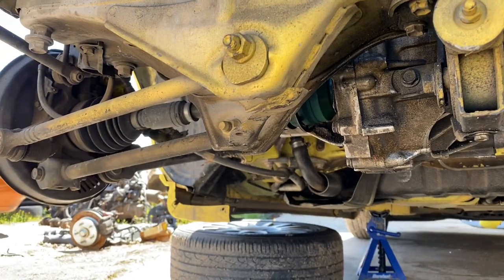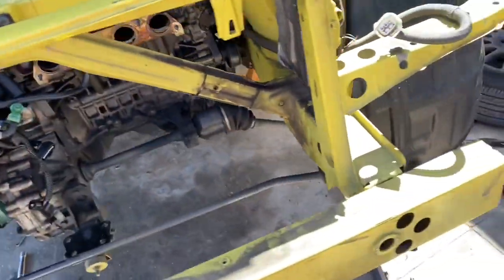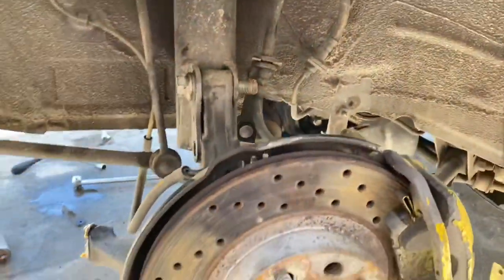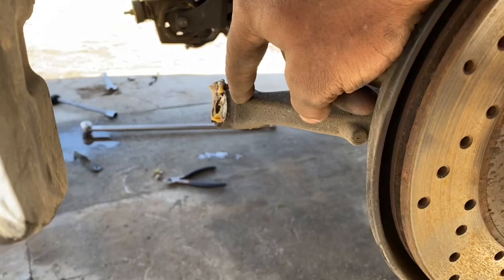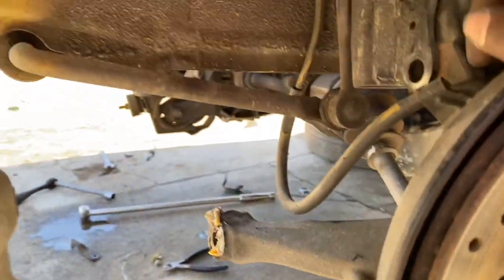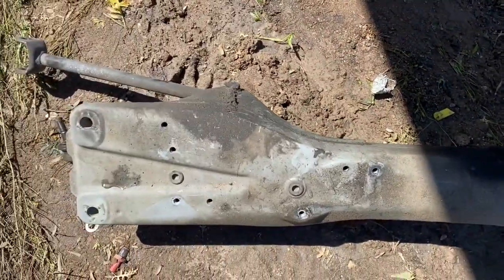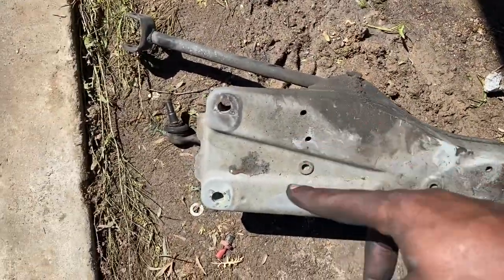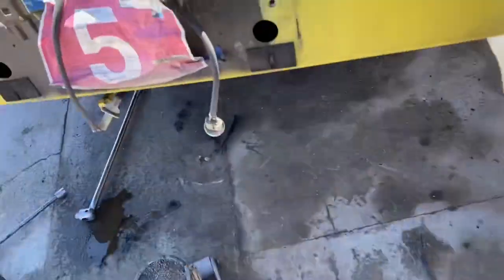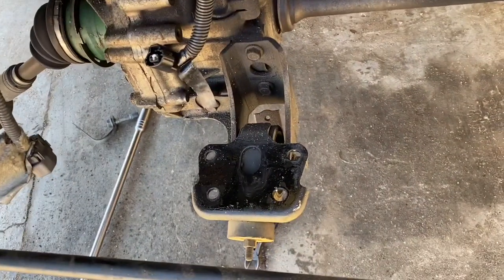We're back — I got my axles popped out of the suspension and put the suspension back up for now. You have to take off the two rods on the subframe, then the two 17 millimeter bolts and it drops right down. The subframe is really light too — you can pick it up like nothing. This car is super light compared to the SW20. All I did was drop those two 17s on each side, and in the center I dropped the four 14 millimeter bolts instead of the 17.